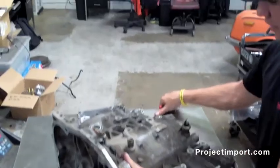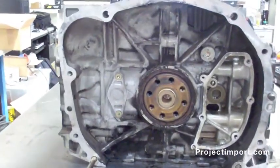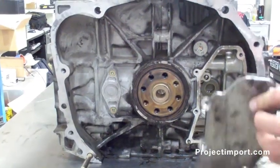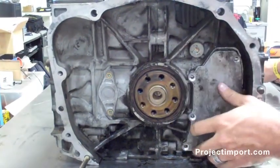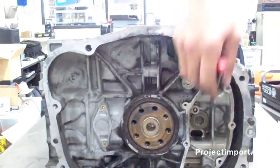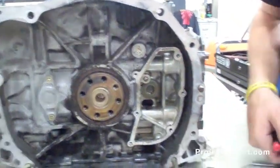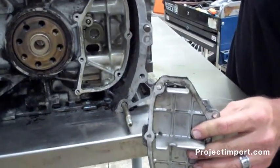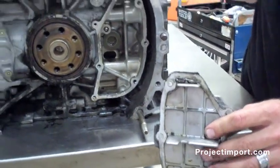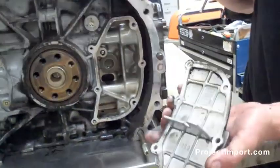When you rotate this block around, you'll find very few guys talk about this. You'll find this plate right here — it's covered, it actually goes on like that. What that is is that this port where you're sucking through sucks crankcase ventilation out through this port and has baffles in it, so you try not to get any oil up in the crankcase ventilation. It's kind of like having a built-in catch can in the motor itself.